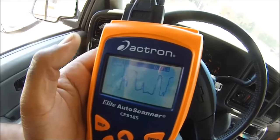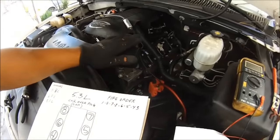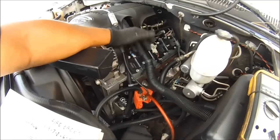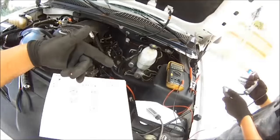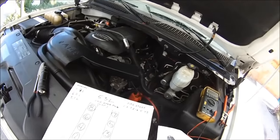That's not a good sign for an O2 sensor. First thing we're doing here is checking the wires. But the first thing you should really do is check for spark in the area where you suspect the misfire — the bad coil or bad wire or whatever. We're going to check the wires just so you guys have a whole range, because you need to check wires sometimes when you're checking for a misfire.